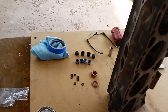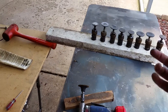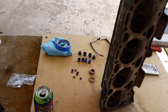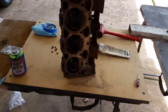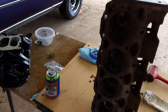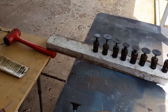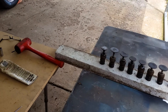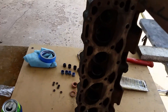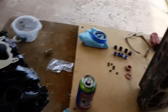It's going to be falling off in the RPM range because the valve springs are too weak, but I remember having a cam go flat on me about 12 years ago — a Comp cam. I called Comp Cams and talked to a guy for a long time. This was about the time they removed zinc from oils, and I learned that lesson because I was just using Castrol GTX off the shelf from Walmart and it didn't have any zinc in it. I pretty much wiped a hydraulic cam because of that. But the guy told me a trick: use the factory valve springs even though they're weak, run it for about 500 miles, then change them out.